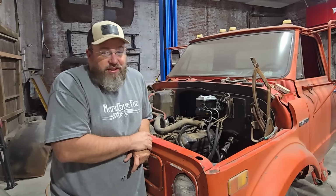But it's running. Our working fuel pump. Well, the fuel pump's working. Okay. It's got fuel right up here too. It sucked it all the way from the tank to there. So we need to put a kit on the carburetor. Probably need to put a kit in the carburetor.